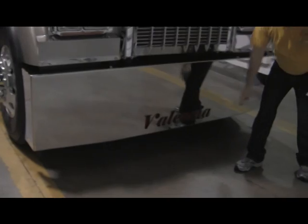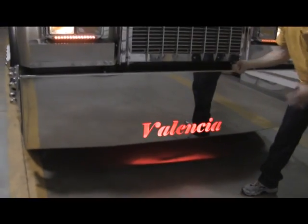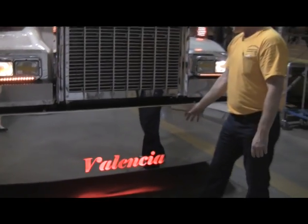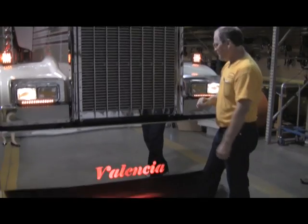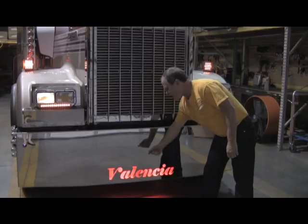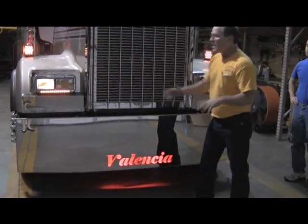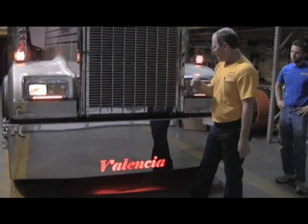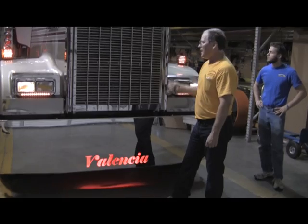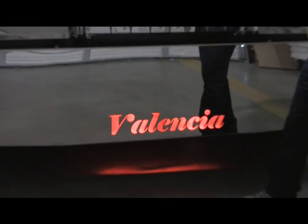The owner of the truck wanted his name cut out in the bumper itself. On this particular truck, if you just have the name emblazoned on the truck, it's kind of hard to see at nighttime. We wanted to match the color of the light coming through the light box with the same spectrum light that we have everywhere else. LEDs are true spectrum lights. We didn't want to use a phosphor light because that would be a little bit different than a standard LED light, and an incandescent light shining through a lens gives a really weird look.